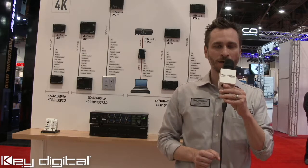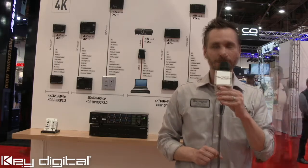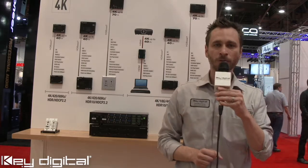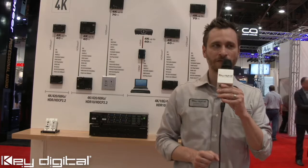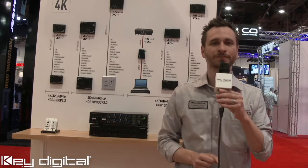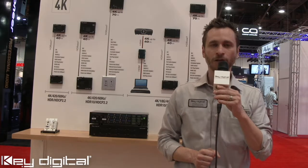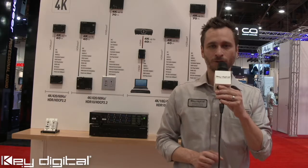The HDBase-T ports 1 and 5 also support long-range mode, enabling 1080p extension up to 500 feet or 4K up to 70 meters. Each of the outputs supports ARC, and outputs 1 and 5 support ARC from the connected RX balun, which can be reversed and returned from the display's HDMI or external TOS link connector. This is controllable via IR, RS-232, or TCP-IP, and because it is TCP-IP controllable, it is also app ready — controllable by KeyDigital's KD app for input-output switching and volume controls per output.